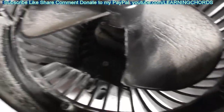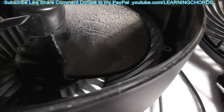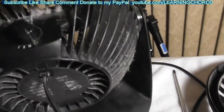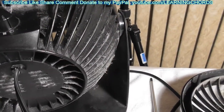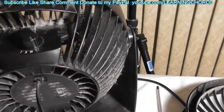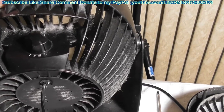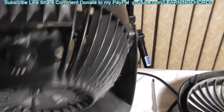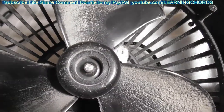This is the inside of the front cover loaded with dust. The propeller blades are loaded with dust. The inside of the cage is loaded with dust. The motor is caked with dust way down there. The back of this thing is covered with dust. So you could take this outside — I wouldn't do this indoors. Take it outside and use a duster blower or a garden blower to try to get all the dust out.